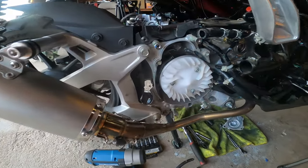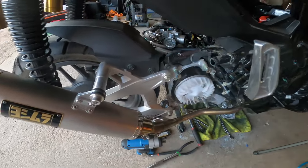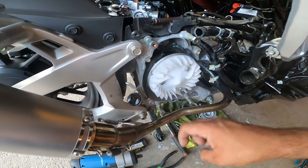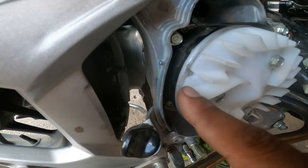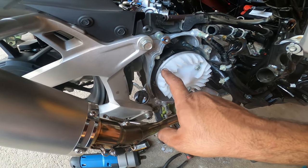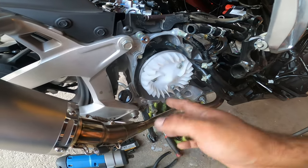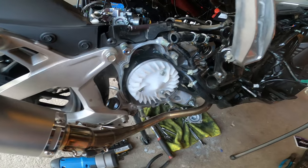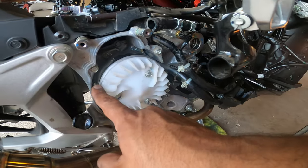Now, the way I talked earlier about TDC on this bike, it's kind of weird. It gets a little deceiving for me. I found the repair manual, so I'm going to give that to you guys in the description down below. You'll see there's a little tooth here, and there's a notch. Use the notch for TDC, okay? Not the little triangle. So I'm going to try to put this at the beginning or whatever. It doesn't cause any issues, okay? Even if you had it at TDC there, all you do is crank it back once, and then this is at TDC.